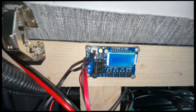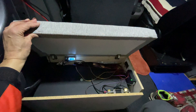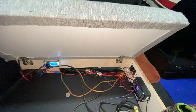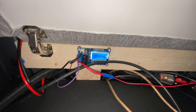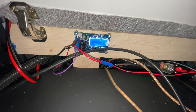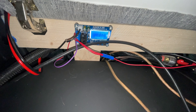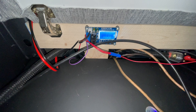Now I'm taking my hand off and letting it cool down again. I'll run this for a while and see if they get hotter than I'd like. The battery's charging — after I warmed it up using the house heater I turned it on and it's registering 11.4 degrees. It's not going to come on until two degrees, so I'll have to see how cold I can get the battery. It took quite a long time in the cold snap to cool down, and it shut down at negative two, which represented zero internally where it was measuring.